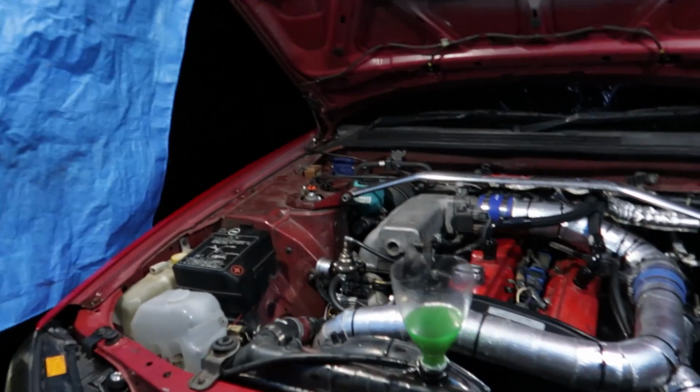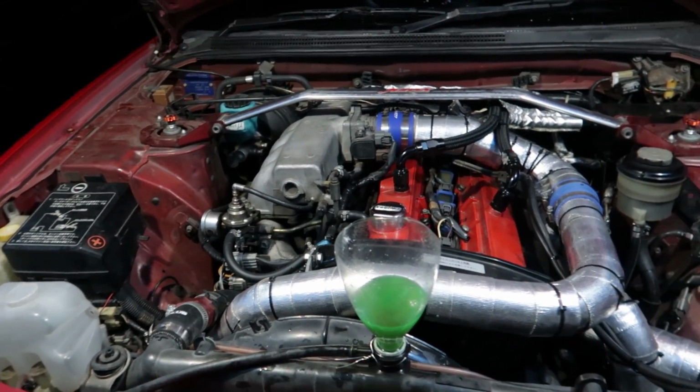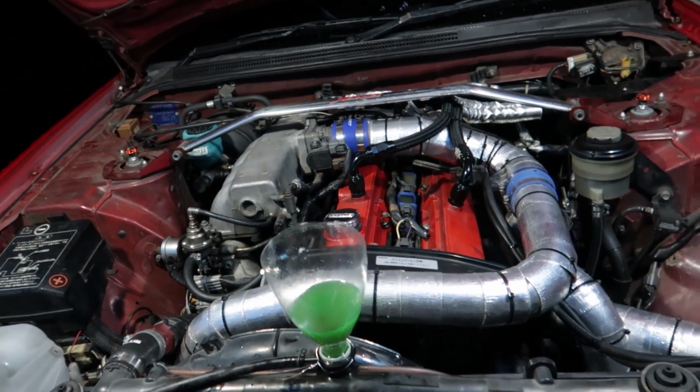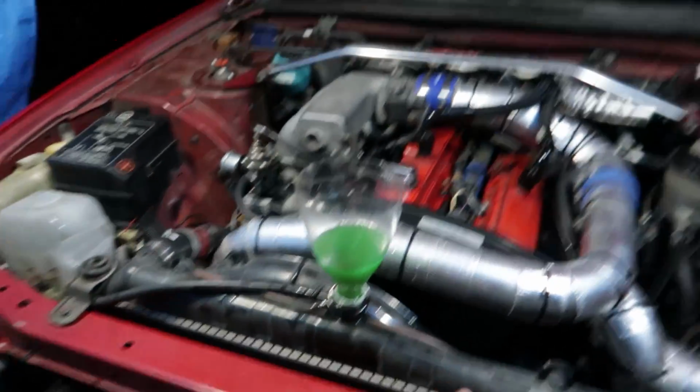Gosh, this thing cracks me up. Anyways, it did its job. We're back on the G7X, so hopefully the head mount turned out really good for those time lapses. We are back at the point of essentially starting this thing up. We've got to bleed the coolant and everything. One thing though is I've disconnected the CAS because I want to let this thing crank over a few times and just make sure there's no weird sounds of like, you know, valves hitting pistons or anything like that.